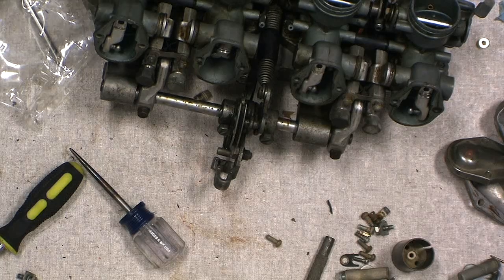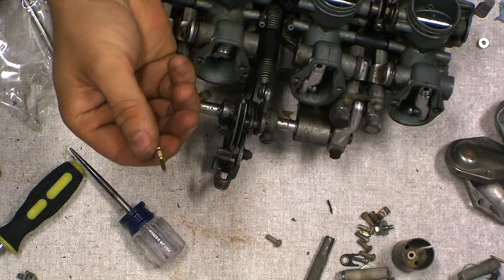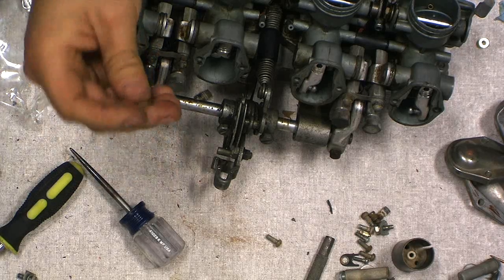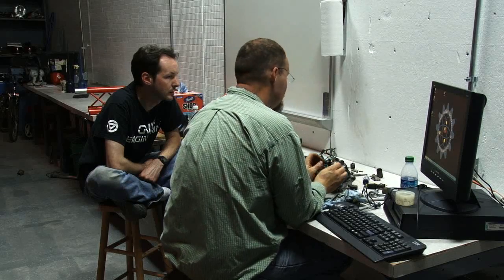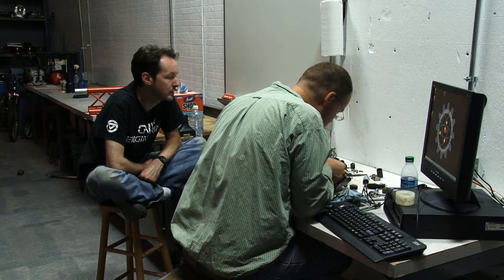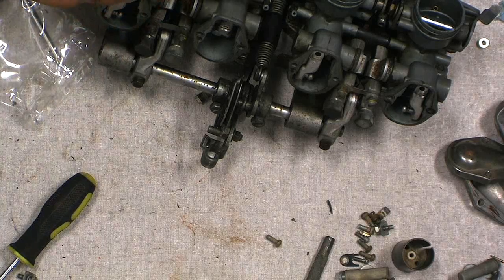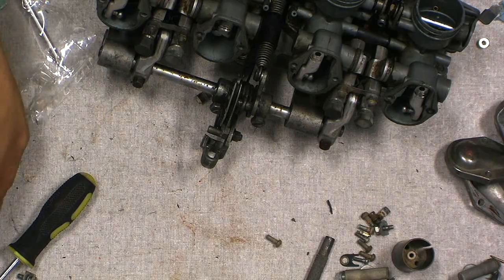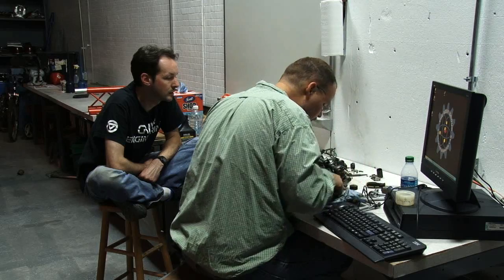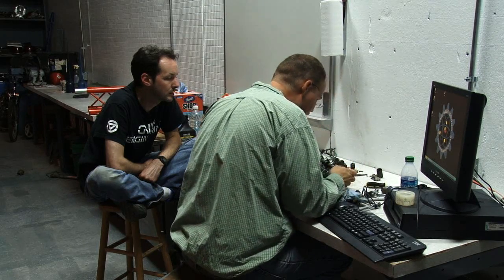When you put sharp objects into these holes on the sides, on any of the jets that are screw-in like this, they don't have a hole through the center. Do not scratch the inside of the chamber if you can. If you're going to use something, a blunt end is great. But just don't scratch the inside. It will disturb the airflow and make things not act right.